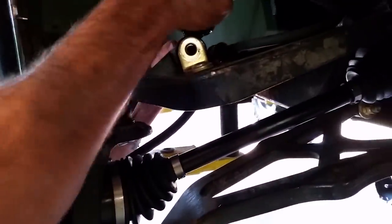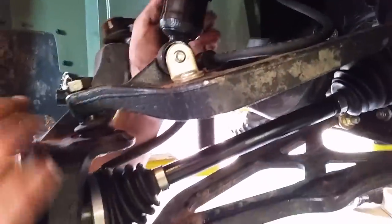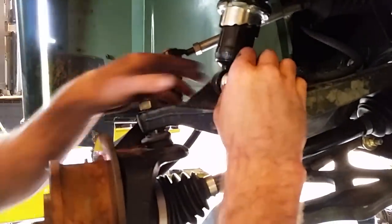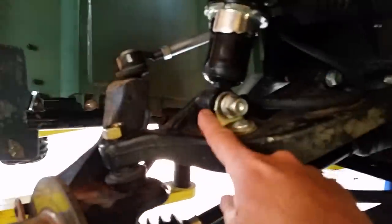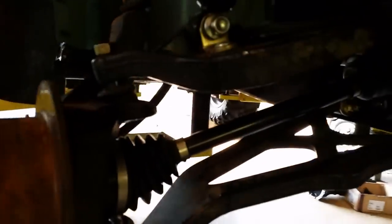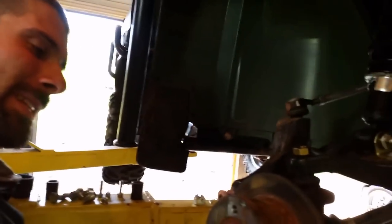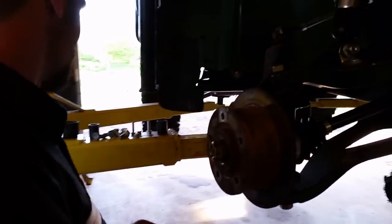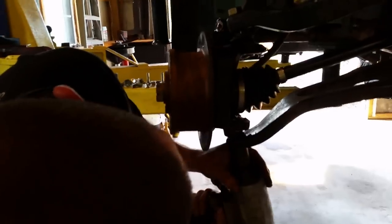Pushing in a little bit — there you go. I didn't lose but maybe a quarter of a quart, maybe. It's level in there — yeah, it's probably half a coffee cup full; they probably overfill it just a little bit. Anyway, we'll double check that. Reattach the shock. We'll put the factory washers back on since it had two separate ones. Squeeze her down — that's it.